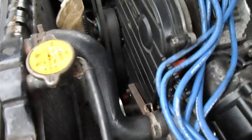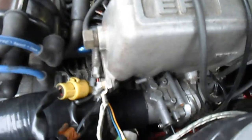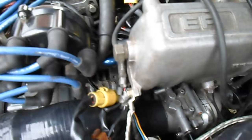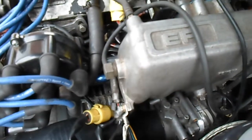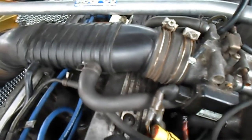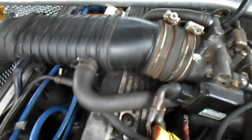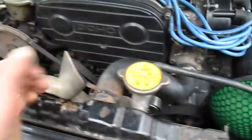Going around into the bonnet of the car — it's now supercharged with the Eaton M90. All the intake butterflies are in. I like to wedge the intake butterfly open because I haven't got the recirculating valve working at the moment, or the VACs. I want to run the engine just as it is for now because it's not running boost into the intake. Eventually that throttle body will be modified and I'll probably remove the butterfly in there.